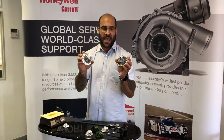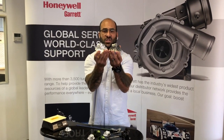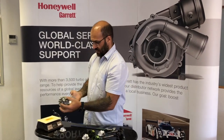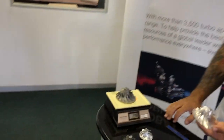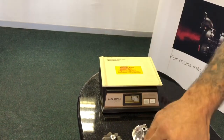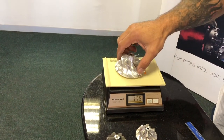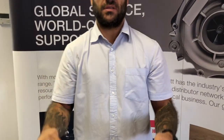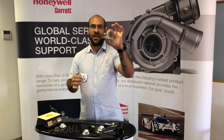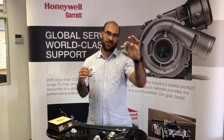Let's compare an industrial application. This is an OM501 engine — a Mercedes-Benz engine — and the original turbo is a Borg Warner. Here is a cast compressor wheel and here is a billet, exact same size for size — inducer, exducer, taper, etc. Cast compressor wheel weighs 166 grams. Billet: 176 grams — roughly a 10 percent weight difference. Yes, the billet will last longer at higher boost pressures and faster rotating speeds, but if you're not running your turbo there, stick to cast. You will have lag.